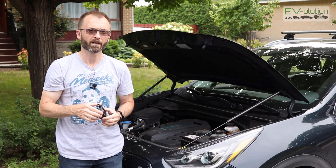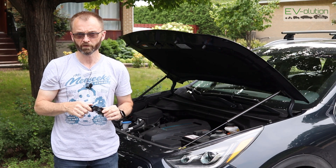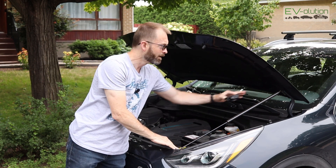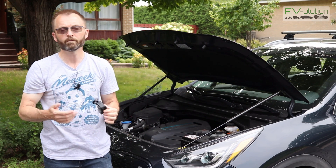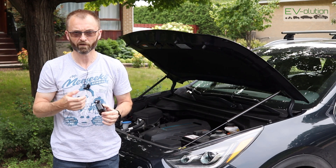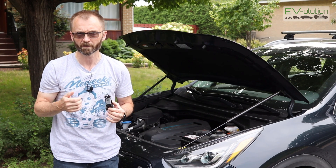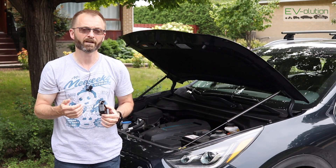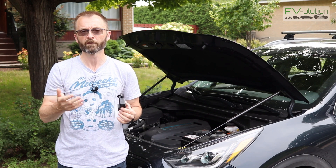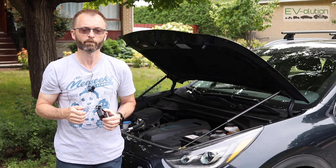There was an important note that I didn't mention in the video but did put in the description: the ball sockets, both at the bottom and the top, needed to be greased. I did grease them off camera and they are installed with grease. So if you purchased these hood struts and didn't grease them, I would suggest unclipping them, sticking in some grease, and that'll prevent them from making noise and allow for longer life, avoiding premature wear.